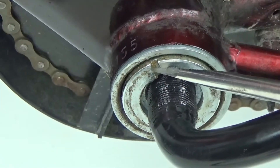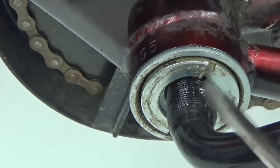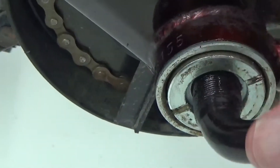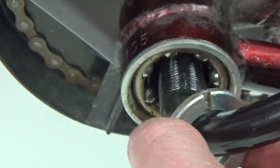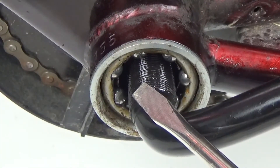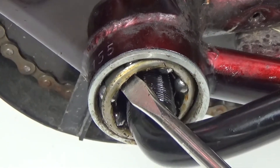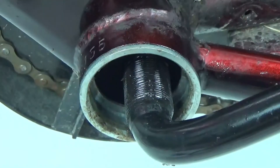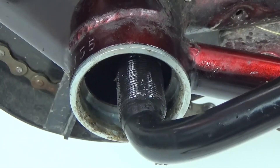Now we're going to remove the spanner nut. There's a little place where a flathead screwdriver will fit in, and you just spin it clockwise again. At this point I can just do that with my finger if you don't mind getting your fingers a little dirty. With that loose, take it off. What we've got showing inside now are the bearings, and with the help of a screwdriver we're going to take those out and off the end of the shaft. With that done, the shaft on the left side is really loose, so we're going to flip the bike around and work on the right side.